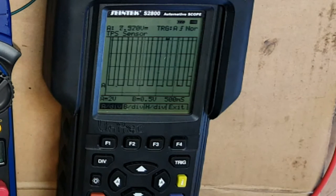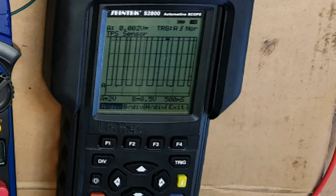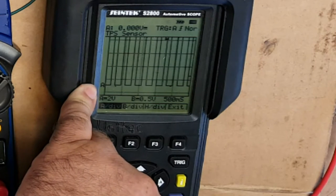You can see the voltmeter now, it's just showing a constant voltage pretty much. Yeah, all over the place again. Doesn't know what's going on, can't cope with it. Okay, so the relay has now given up, it's not actuating, the bulb's gone out. So essentially, the supply to the bulb will be zero and we should flatline on the screen any second now, when it resamples, of course, hopefully.